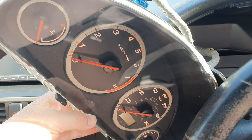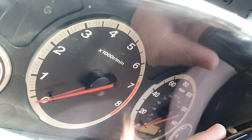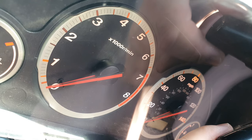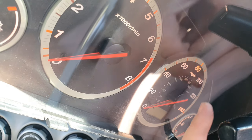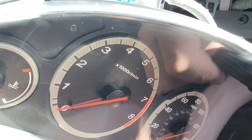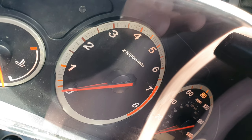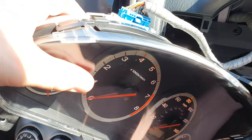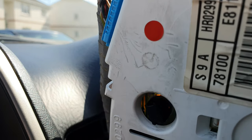I don't know if you can see this but I have the lights on. There they are off, there they are on. You can see the 80 area is brighter than the 60 area because of where the LEDs are placed. I've replaced all of them, but only certain areas are showing light. The reason some spots are dim is because there's actually no bulb socket at the back of that position.